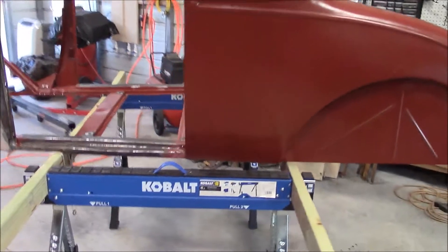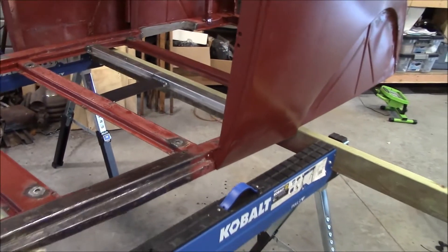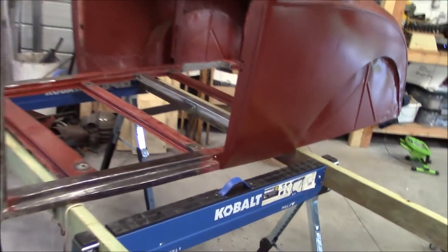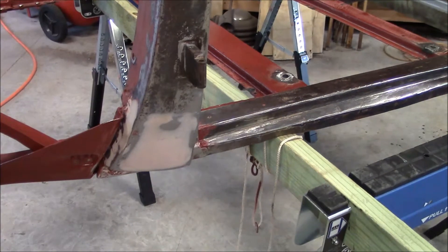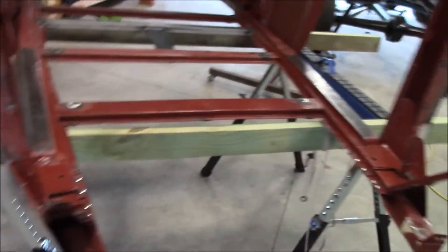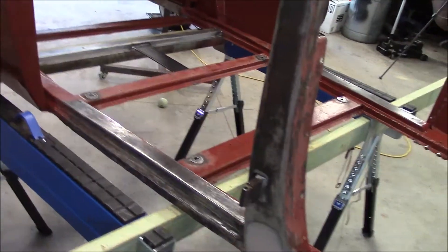I have the bottom all prepped and sanded, wiped down, and all that. I also went ahead and took care of all the areas I hadn't prepped and primed before - the crossmember, added a little filler on the bottom of the A-pillars where I did my patches. The front here I had primed earlier with just a brush just to stop the rust, so I sanded that smooth. I'm going to spray that so it looks a little better. Next is to spray the primer.